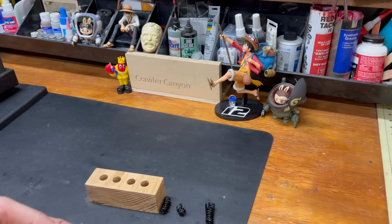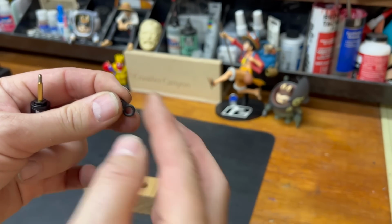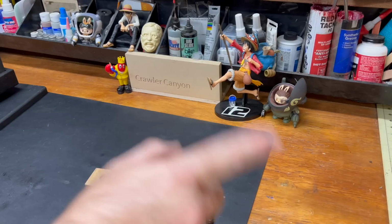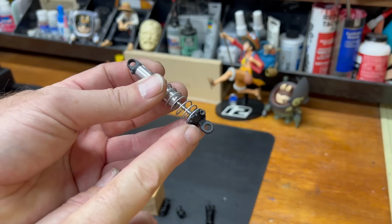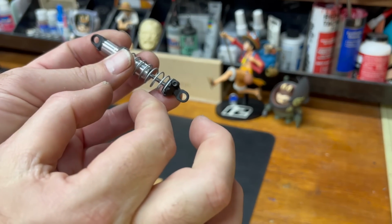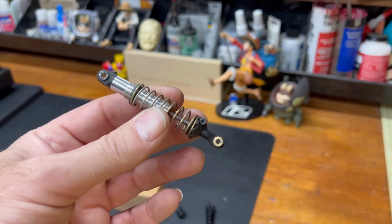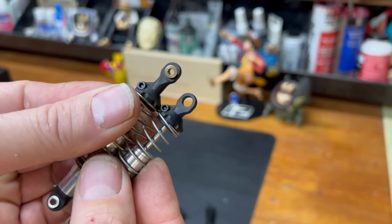So what you can do is, Desert Lizards come with a very small eye on the end. You can just put another eye on the bottom of the shock, make it a little bit longer, and then you've caught it back up. Incision does that. On these, this is the medium, and then there's a longer one and an even shorter one. So you can really customize a couple millimeters difference in length. I'm using almost all of those Incision ends. Yeah, there's a longer one. Where's that short one? Yeah. So see, you really can fine tune the length of the shocks.